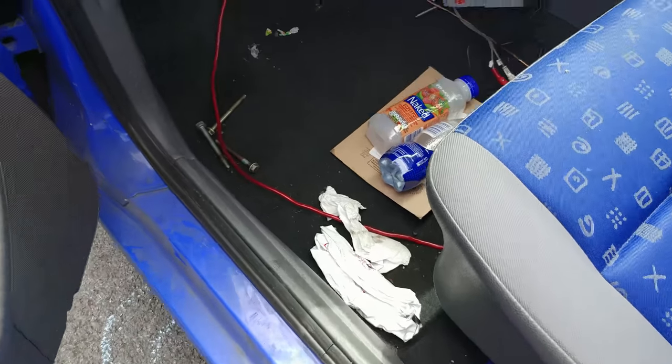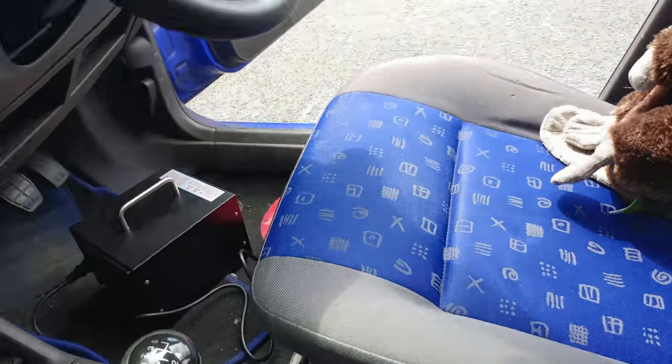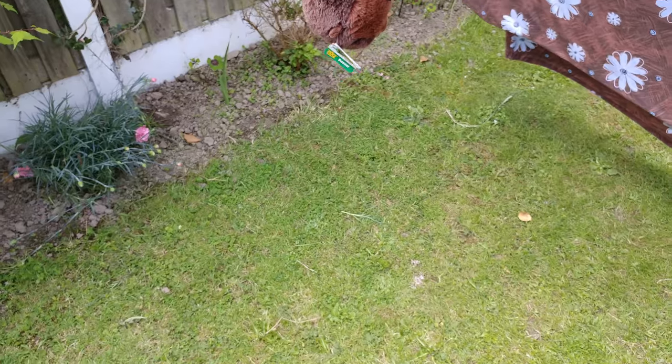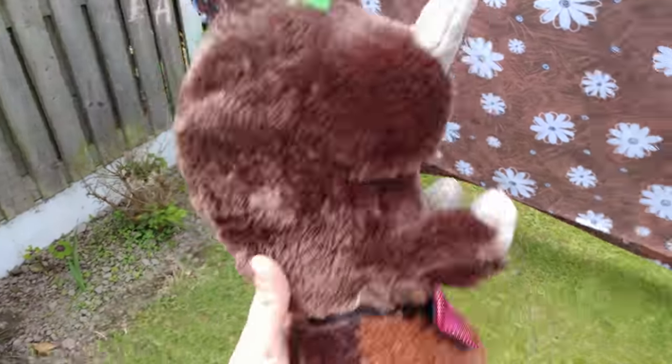You have to be aware that an ozone generator is not going to do any physical cleanup in your car — it's just going to remove all the bad smells. My beaver is getting ventilated as well. I'll be back in a couple of hours. The life of ozone generated by this or any other generator depends on the humidity, air temperature, and exposure to sun. So if you still smell ozone in your car, just ventilate the vehicle or room again and in a couple of hours it should be perfectly fine to live in or to drive.